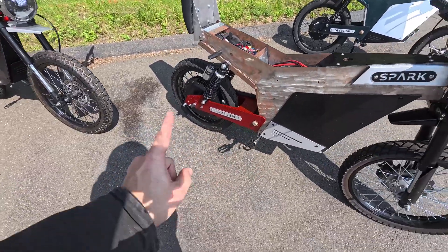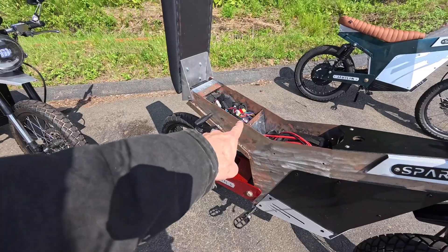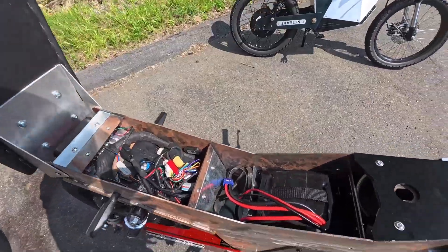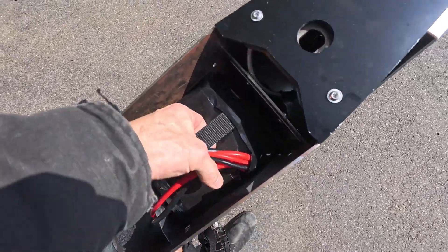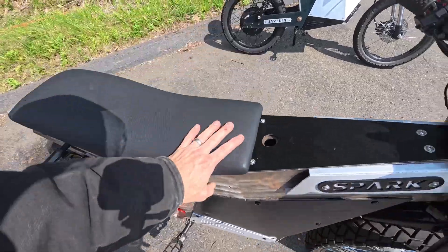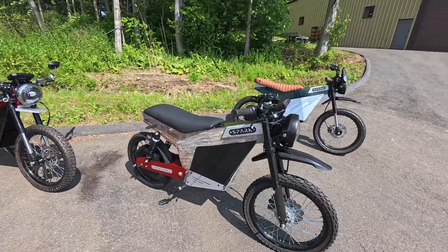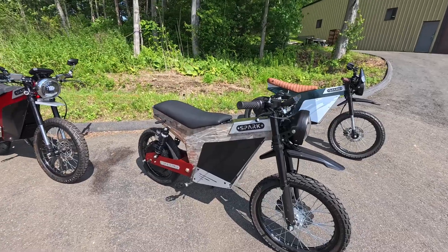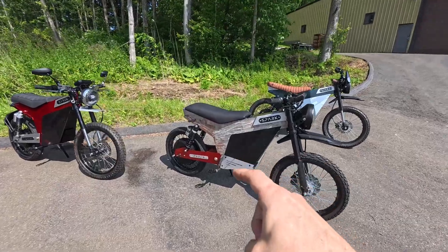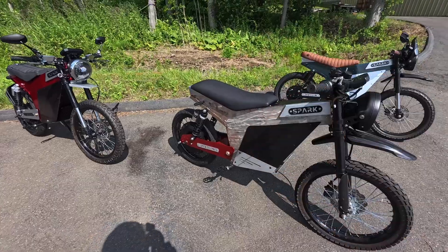If you did a kit on a Gen 1 Javelin, this would also work, but we'll use a slightly different Far Driver controller to make sure it's all plug-and-play with your bike. So you get an upgraded controller, and on the inside you get an upgraded battery from Powerful Lithium. That right there is a 59-amp-hour battery using Molicel P45B cells. It is just an unbelievable combo — an 8-kilowatt motor in the back, plus that monster battery, plus an extended swing arm, plus an updated controller.